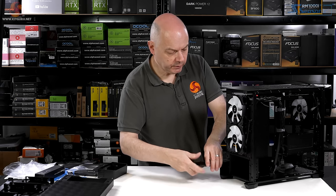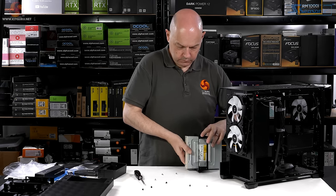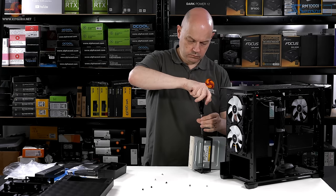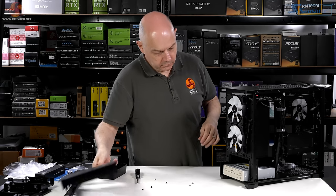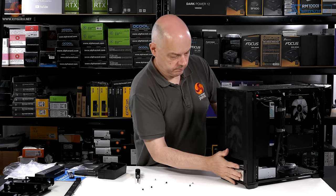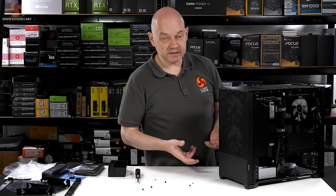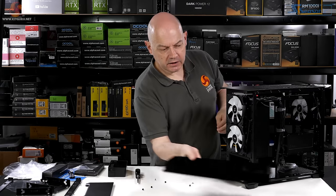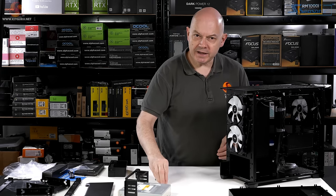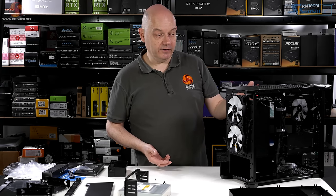As with the Pop, we remove this bracket, and you can install one or two optical drives, or a combination of optical drives, full-size hard drives, SSDs — and of course M.2 storage on your motherboard. It really does seem that Fractal Design has decided to put a huge emphasis on storage options. My guess would be that they don't think for a second anybody's going to install eight drives in a case like this — it's that it doesn't cost them any great amount of money to do this.